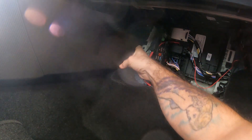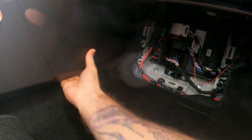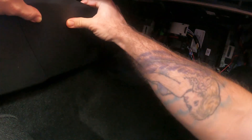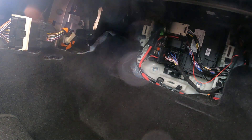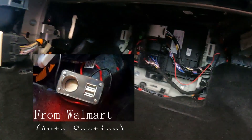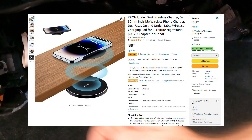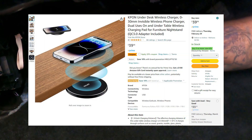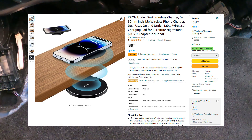My first steps were to access the fuse panel and to access underneath that little dash storage area. What I did is I got a 12-volt fuse, a 12-volt powered USB adapter to power it, and then I got an under-desk wireless charger that was powered via USB.